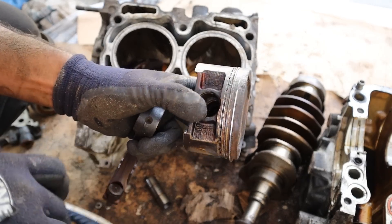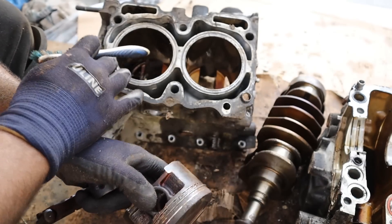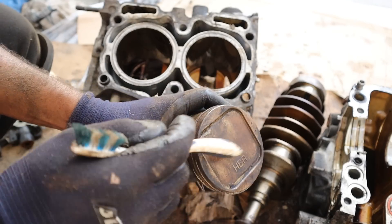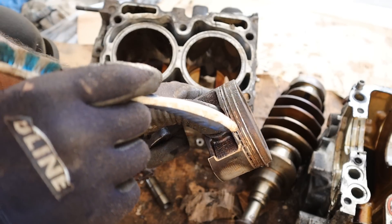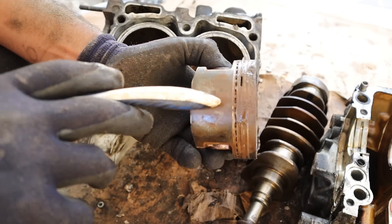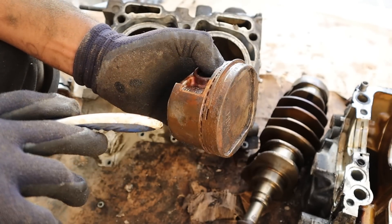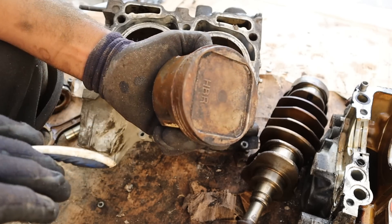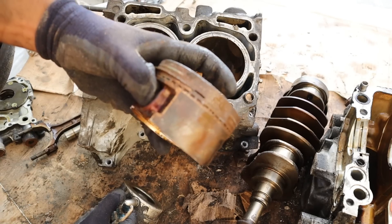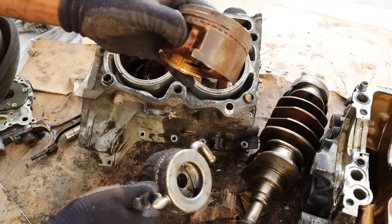Sometimes when you push these engines too hard, the notches that hold the rings can actually blow out a hole — that's called ring land failure, and you're going to lose compression. Subaru is also not immune to typical oil burning problems. The oil control ring inside of here is pretty gummed up, and that's going to prevent oil on the cylinder wall from escaping back through that ring and draining to the sump — so it ends up on the combustion side of the piston and you burn it. The piston that was full of that oil-coolant mix has made a muck inside, which tends to clog up control rings, because oil and coolant don't do each other's job — coolant is not good at lubrication and oil is not good at cooling, so you get engine failure if you run it too long. Oil and coolant mixing is likely due to a failure in the head gasket, the radiator, or the oil cooler itself having an internal leak.